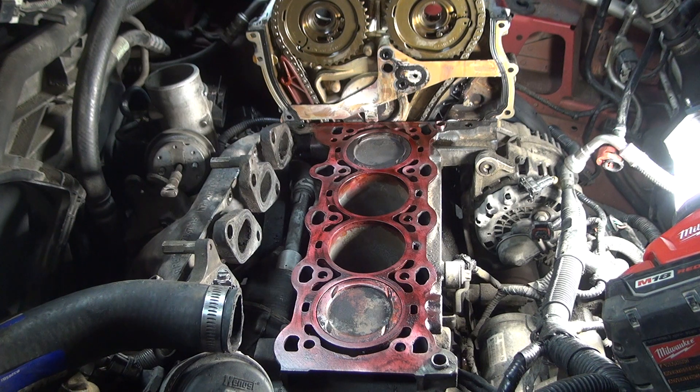That was my main concern before throwing a rebuilt cylinder head on. The head was 0.009 inches out of spec — warped. So it either has to be sent in for machining or replaced. I'm leaning towards just getting a rebuilt one; I think they're about 600 bucks. But first I wanted to check this engine block.